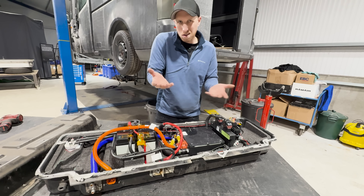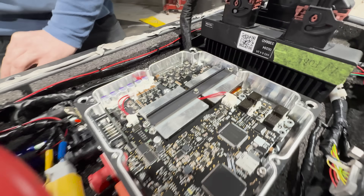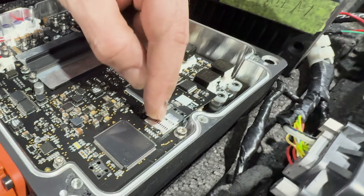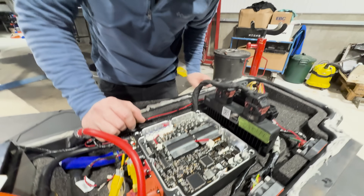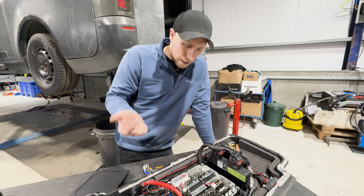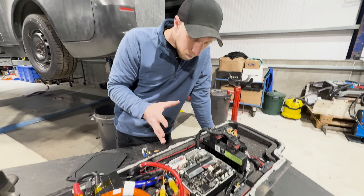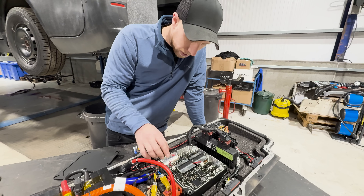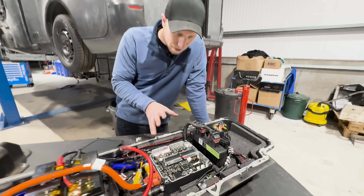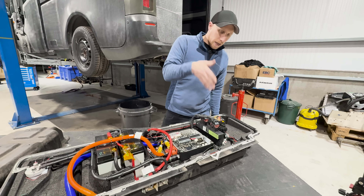Most vehicles now are going DC-DC charger all-in-one. Let's pop the bolts off for a quick look inside this DC-DC. What I find quite interesting is there's a 64GB SD card buried inside the DC-DC — I can't say I've ever seen that before. I'm probably going to plug it into my computer and put a short out about what was on that card, as it may have been doing lots of data logging. This item is liquid cooled for a DC-DC, so it's probably a really nice unit, and as normal from Arrival all the PCB design work was done extremely well.